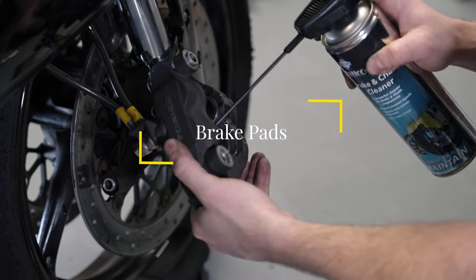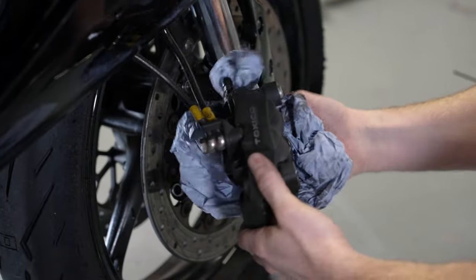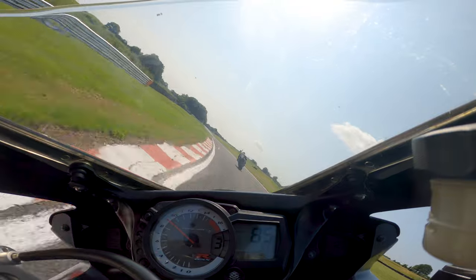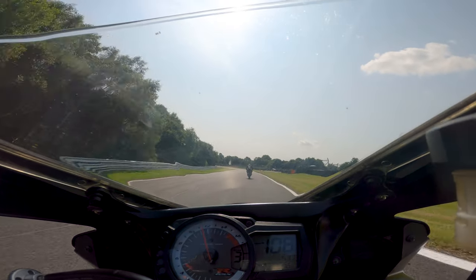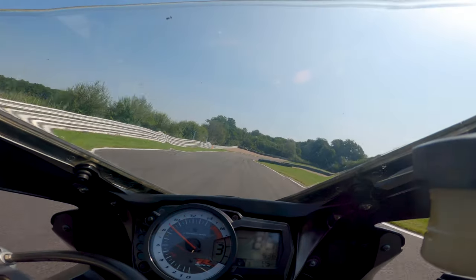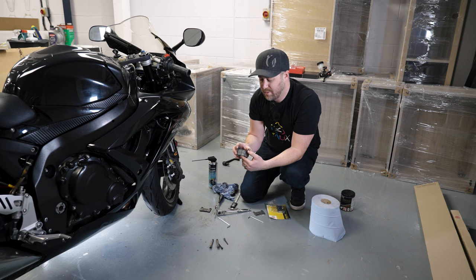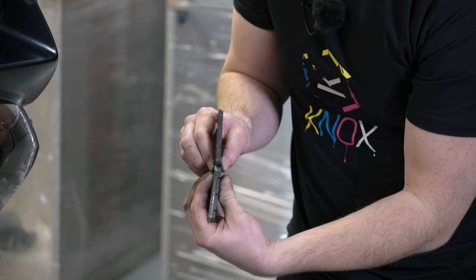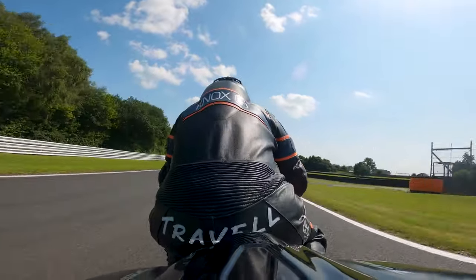While I've got the master cylinder off and all the fluid out of the system, this is the perfect time to change the brake pads again. Since the last video I've actually changed the pads a couple of times — originally on the 806 RS pads, then the 806 RST, the newer race-sintered version designed to last slightly longer. What you find about race-sintered pads on track is you're going through them like there's no tomorrow. This pad I've just pulled out has been on two track days and it's about 70% cooked. I don't really want to run another track day on it — I want to go to the first one in 2022 absolutely flying.